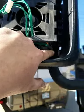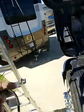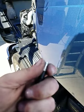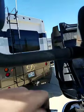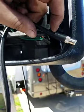And I went with a Firestik dual CB antenna adapter. Let me grab that. Okay, so the Firestik kit that I ordered has 2 of these. You can unscrew the CB end off of this, feed this through, push it through this pipe so it comes out at this end here so you can fish it over into the rubber boot. Again, like I said, there's no way you're going to get that in there without having issues with the boot here.